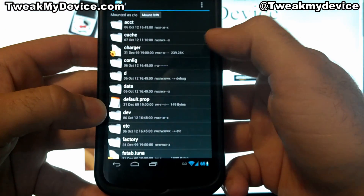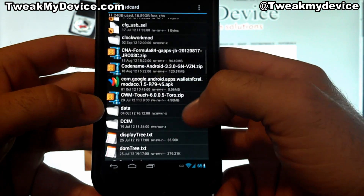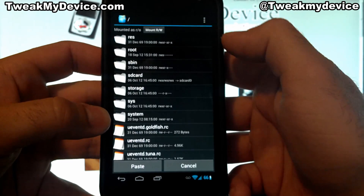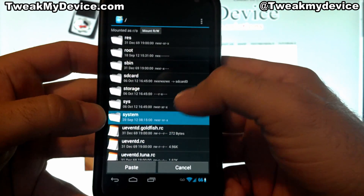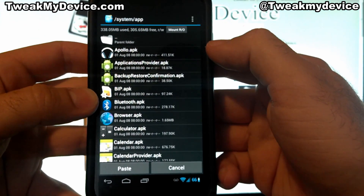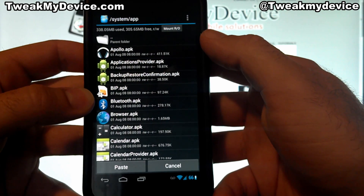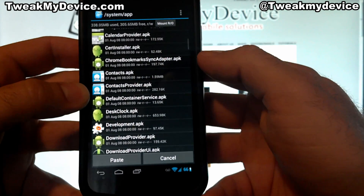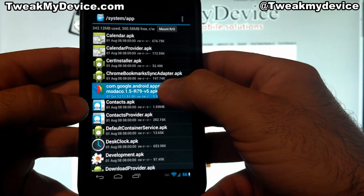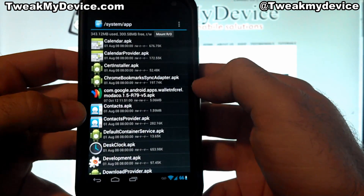Now back out and go up to your parent folder, then back to the SD card. We're going to copy this one more time — we're going to put it in one more place. Go up to parent, and this time go into system/app. Once you're in system/app, you have to tap to mount RW. Once you've tapped it, it'll say mount RO. This is where you want to put this, so go ahead and paste. Again, we want to change permissions — tap and hold, permissions, and uncheck write for group. Hit OK and back out.